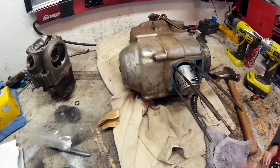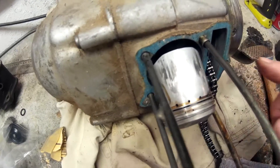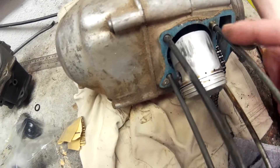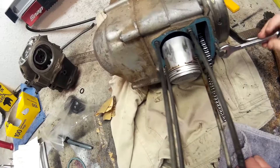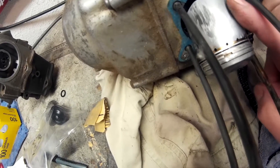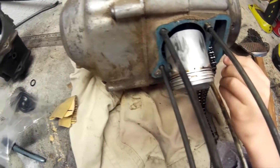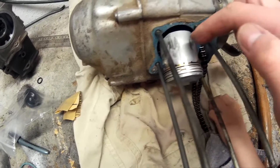I've got the whole cylinder head off and I'm looking at the piston right now. Right there I can see score marks on the piston, so I'm going to have to investigate that. We're looking at the piston here and it looks like something rubbed against it. I can feel a little bit with my fingers. Inside the cylinder wall there's a little bit of pitting. I might have to replace the piston — I'm going to replace the piston rings — and I'm hoping I'm able to fix the cylinders.